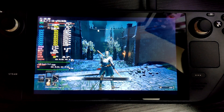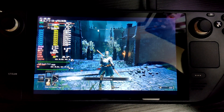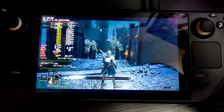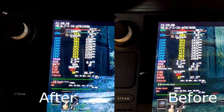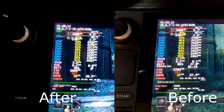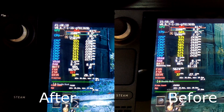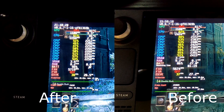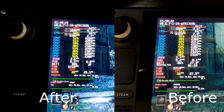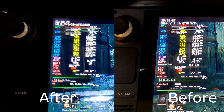Now let's see our results — and it's worse. The CPU and GPU temps are at about 85 to 86°C and 82 to 83°C respectively, with the same fan speed. This is within what I would call margin of error, but in my opinion it is definitely enough for me to conclude that replacing the thermal paste on the Steam Deck is completely unnecessary. Kudos to Valve for not cheaping out with a lesser quality thermal paste — it would have been really easy for them to do that, considering meeting the price point of the deck was not a simple thing, and I am sure they are not actually making money on selling this hardware.